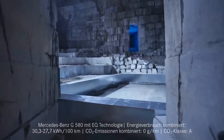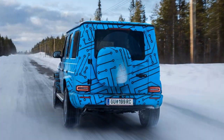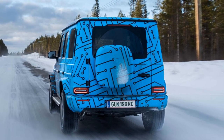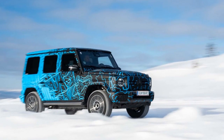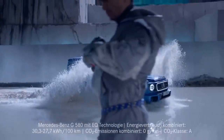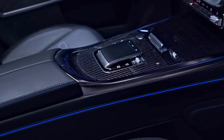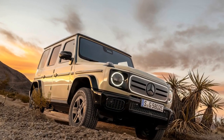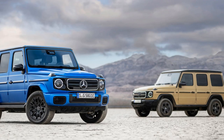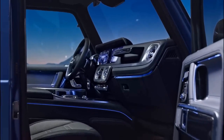The G580 looks much like its gas-powered counterparts, the G550 and AMG G63, which is intentional. While there are a few subtle aerodynamic tweaks, they aren't immediately noticeable. The most obvious distinguishing feature is its slim rear cargo bin, which holds a charging cable where the spare tire would normally be. However, you can opt for a spare tire instead. The G580 remains a body-on-frame SUV with identical mounting points, though the frame differs significantly to accommodate a 116.0 kWh battery pack. Positioned between the frame rails, the battery replaces the latter sections of the frame and acts as a stressed member, with cells spaced out to include structural reinforcements connected to the frame.